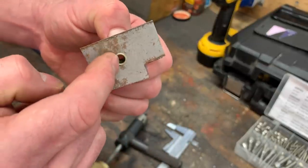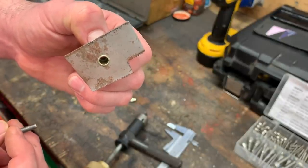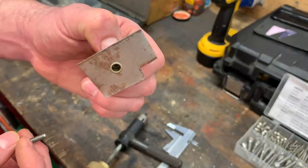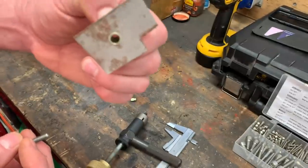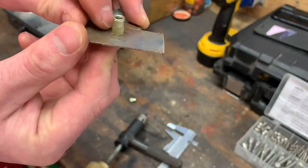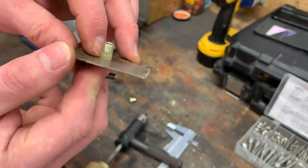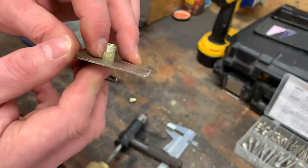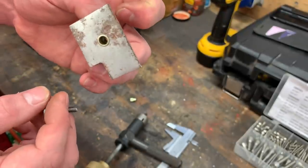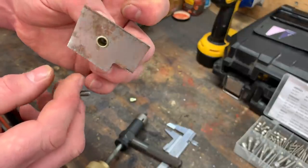I will point out that these are for light duty only. I once saw a post on Facebook where people were talking about using them for seatbelt anchor points, and I made a point of replying saying absolutely do not use these for seatbelt anchor points — on the back they only have a small contact surface with the plate, and if you put too much load on it, it'll rip right out of the steel. They're not for engine mounts or seatbelt mounting points — they're for light duty stuff such as wing mirrors, small brackets, that kind of thing.